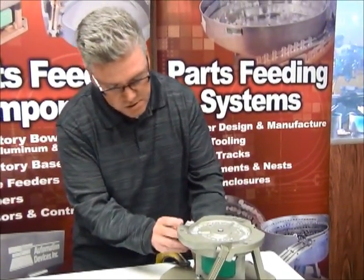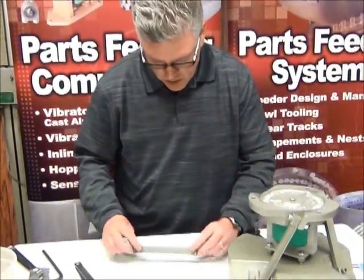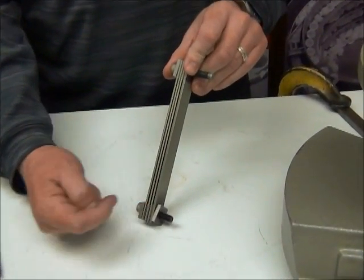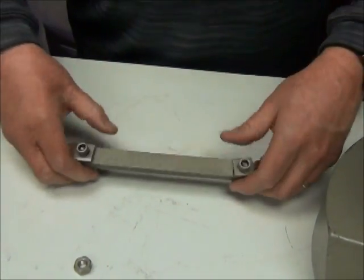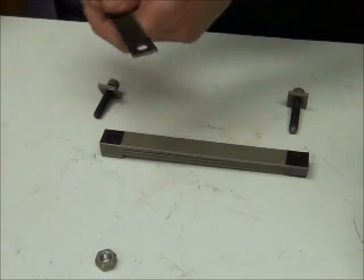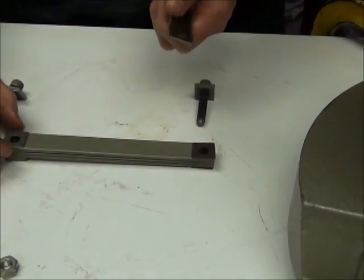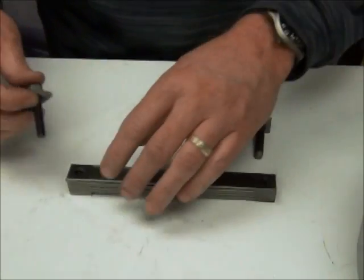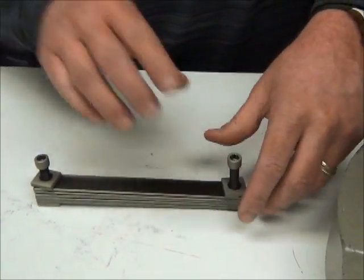I'm going to take all of these off at once. If you look at what I have here, I have springs that are different thicknesses — the thickest one and then there are three thinner ones. What I'm going to do is start by adding one thin spring, just stand it right up and pull that off. I have to add a spacer in between each spring just to space them out. And even though they're not painted, that really doesn't matter — it doesn't affect the performance.